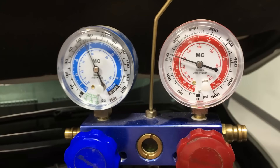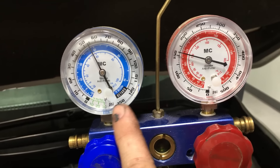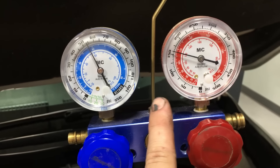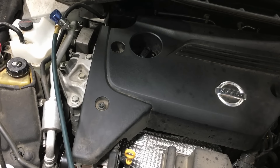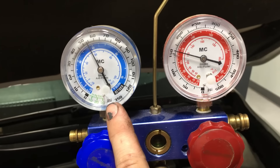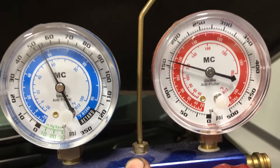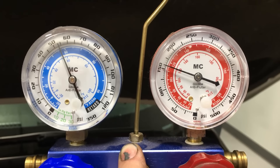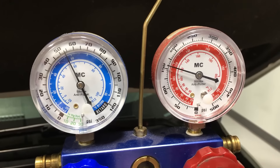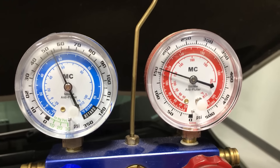The refrigerant control valve electronically keeps the low side and high side separate and regulates the amount of flow between them. The compressor can essentially stay on all the time, reducing drag while driving for fuel economy and reducing idle sag when the compressor cycles on and off. When the valve fails, you're going to get pressures just like this — this is textbook. Compare it to your system, make sure you've done all your pre-checks, and if you're still getting these pressures and it equalizes steadily when you turn off, you don't have a TXV issue either.